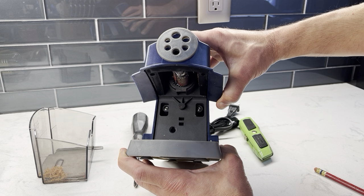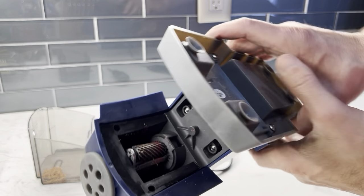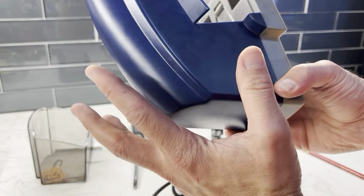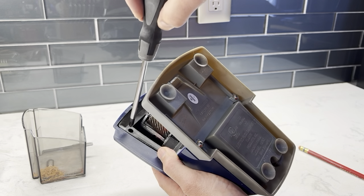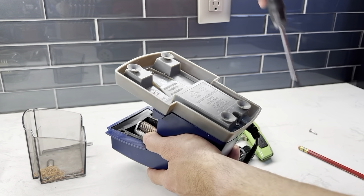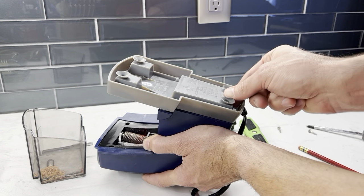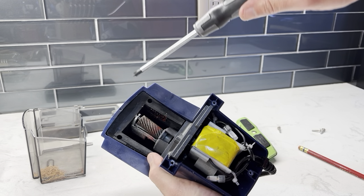What you want to do if it's not running is take the tray out. Inside here is the sharpening unit, and it actually rotates around some gears. To get access to that, you need to take this blue cover completely off. All you need is a Phillips screwdriver — get one that is relatively narrow because these holes are pretty small. First we'll take the bottom off; it's really just three screws, no big deal. The bottom cover comes right off — set it aside — and it gives you a little better access to these holes.